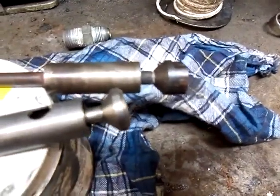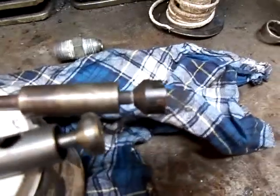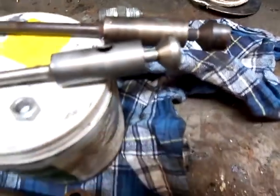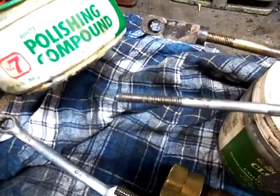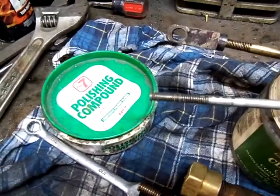You can narrow that seat. You don't want that seat inside here to be a real wide seat — you want to have a nice clean seat. Here's a compound I just used, Cloverleaf 320. Kelly Williams talked me into using this number seven polishing compound. They get it real nice so it don't leak.